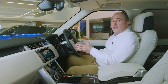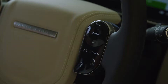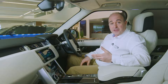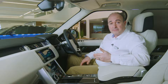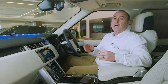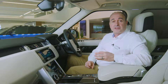If your car has adaptive cruise control, a radar monitors the speed of the car in front of you. If they're traveling slower, the car will automatically match their speed. The buttons on the left and right will increase and decrease the distance between you and the car in front. Whilst you need to be traveling over 20 miles an hour to activate cruise control, adaptive cruise will match the speed of the car in front all the way down to zero. If the traffic restarts within three seconds your car will pull away with the traffic. Any longer than that then you'll need to give the car permission to go with just a gentle press on the accelerator. This function means that adaptive cruise control can be used in tiring stop-start traffic situations.